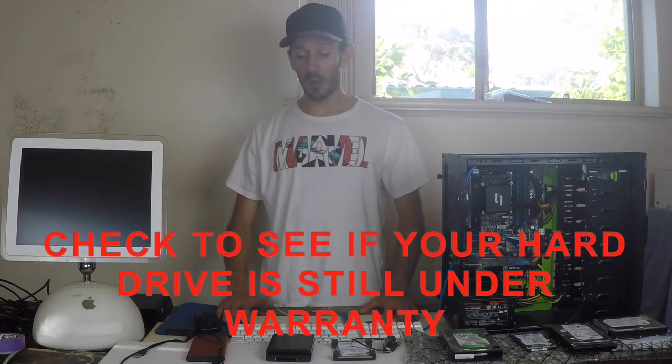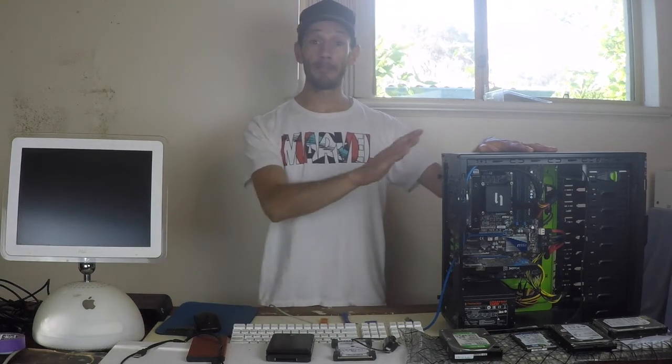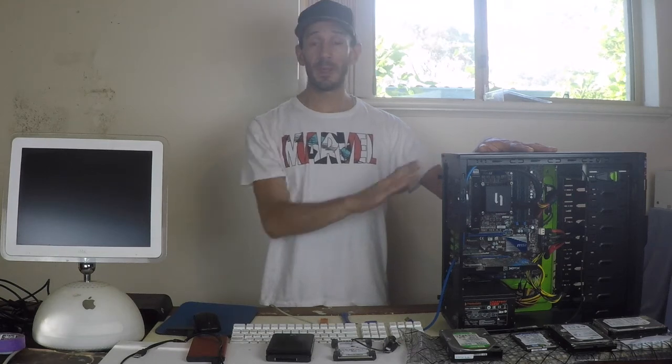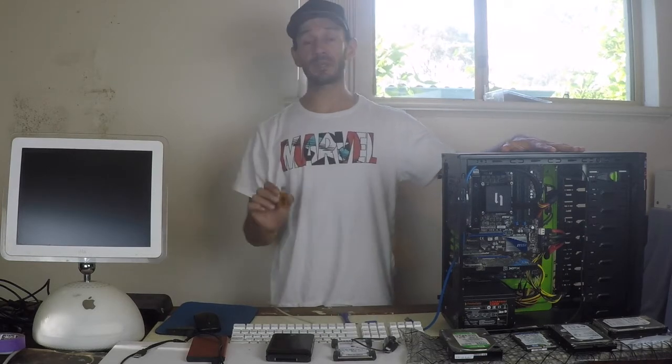There are a couple of reasons why. When you're looking at a hard drive, they are extremely sensitive, so they do use specific tools, and also the other issue is security. If you give your hard drive to just anybody, they'll plug it into their computer and they'll have access to all your files. Even if you don't have sensitive information on there at the moment, data that was saved on there before may still be able to be recovered. Professionals will use a live operating system, which enables them to look at your data without actually storing any of it. It's stored on the RAM, and I'll actually be using GParted, which I'll leave details for in the description section.